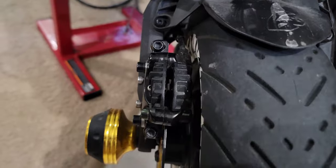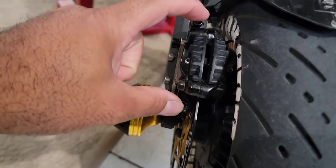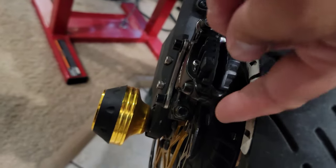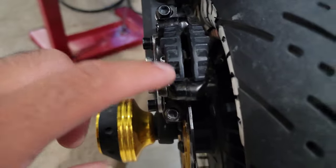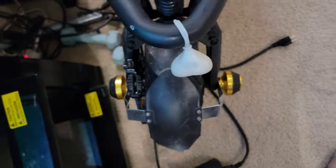When the rotor is properly centered between the brake pads, the wheel spins without any noise. If it makes noise, loosen those two screws just a little bit and tap the entire caliper assembly left and right until the rotor is centered between the brake pads. That is how you get the NAMI and any other electric scooter to stop making noise while riding.